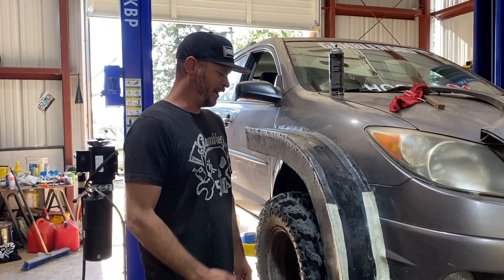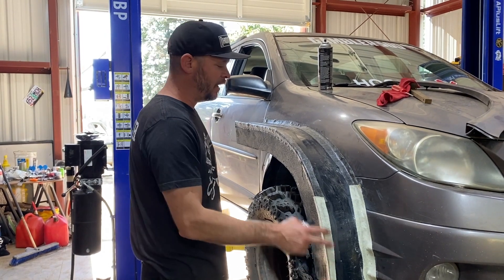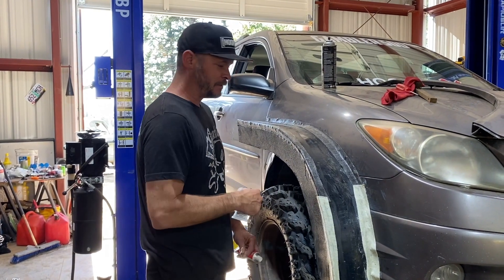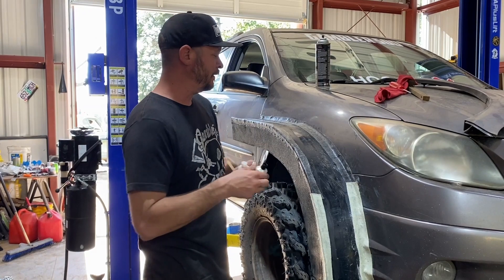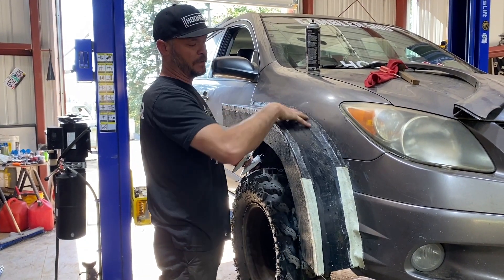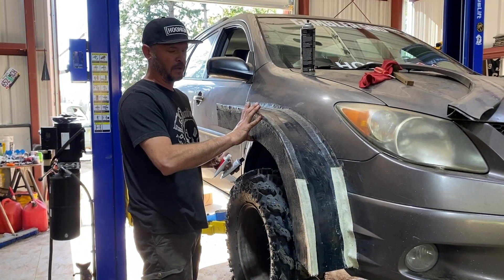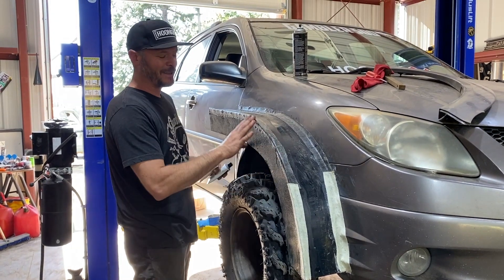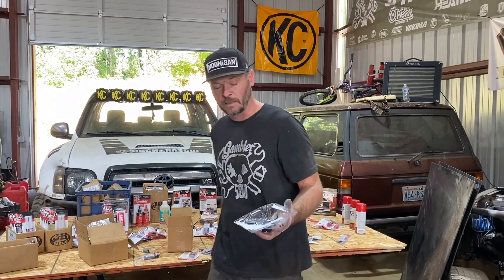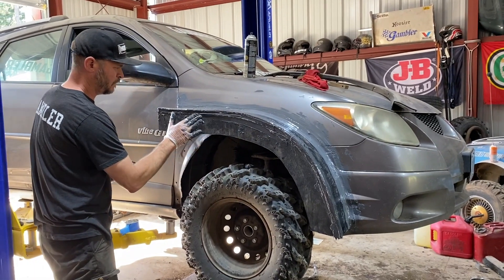Taylor is the fiber fix aficionado. We've got the outer skin done, the steel stick in there, the fiber fix on there, the plastic weld on there — now we're going to take the JB Weld and basically skin this whole thing. I'm trying to get a positive connection to the body and integrate that into the fender to make it as strong as possible. We're already feeling pretty good about it and everything's not even set yet. I have this weird dream of being able to stand on this — I just mixed up the most JB Weld I've ever seen. It's all good stuff when it comes from JB Weld.